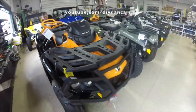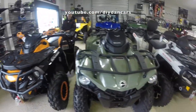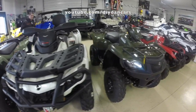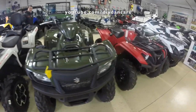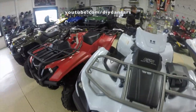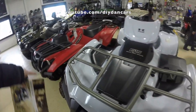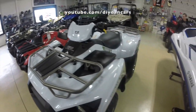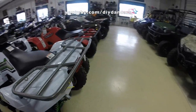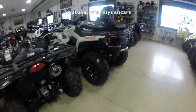So what do you get for your $8,500? The drivetrain includes Can-Am's 570 engine mated to a CVT transmission. The engine puts out 48 horsepower, and the XMR comes standard with Can-Am's proprietary Visco-lock system. Basically, it's Can-Am's version of a diff lock. One of the front wheels has to slip before the differential lock will engage. The spinning axle engages a hydraulic pump in the differential, which engages the clutch pack and locks the differential. The slipping wheel must make several rotations before the differential will lock.